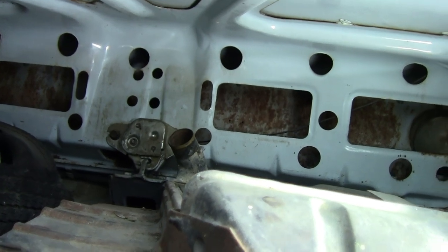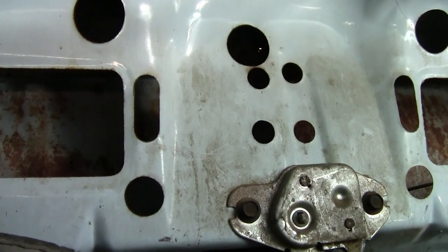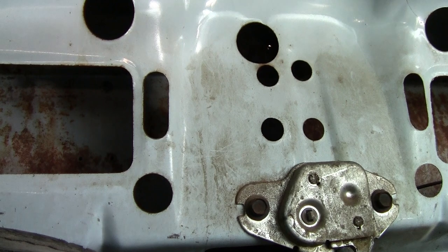I don't know how many old cars I've come across where people have just destroyed the trunk lock trying to dig it out with a flat blade screwdriver and a drill bit — when it's so easy if you just go through the other way. All right, so stay tuned — we're going to go through the trunk and get that latch undone. You can see right there, that's the trunk latch. I'm going to get on there and undo that, set the camera up, and grab the ratchet.